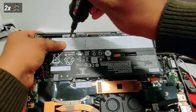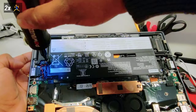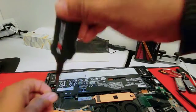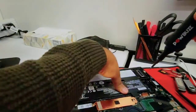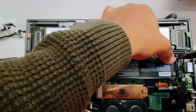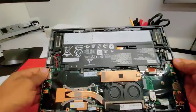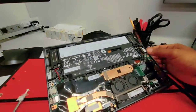I tried to leave all power sources as the last thing I connect to the motherboard — that way you avoid damaging any component on the system board while you're working on it. You don't want to have any power source connected to the motherboard. The new boards are really picky — they are delicate and can be damaged easily. Once you're done, make sure everything is connected. Take a quick look and make sure you don't forget anything.